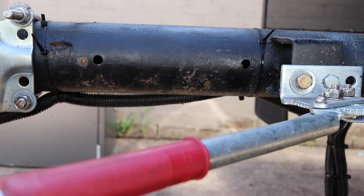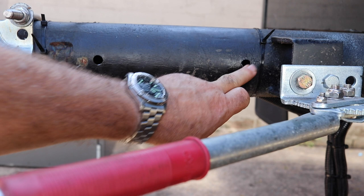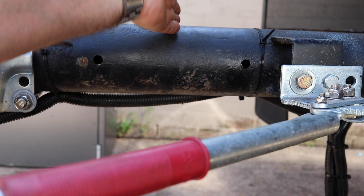Now I've got the holes drilled out for the plug welds on either side of the drawbar. I just need to flap wheel the holes and around the center section, so when I go up to welding Stig, he can just cut it and weld it.